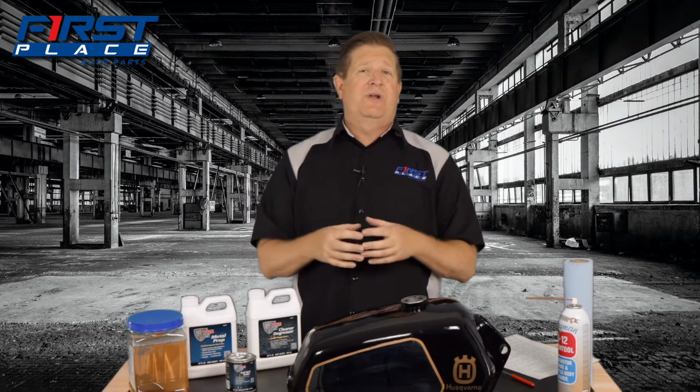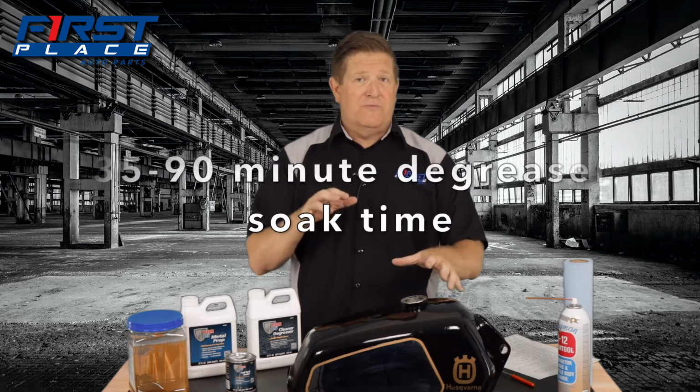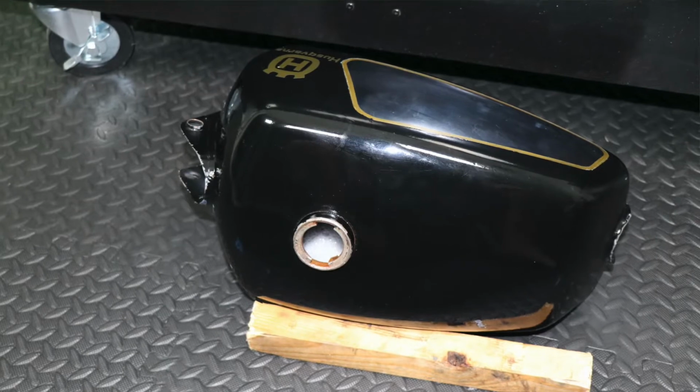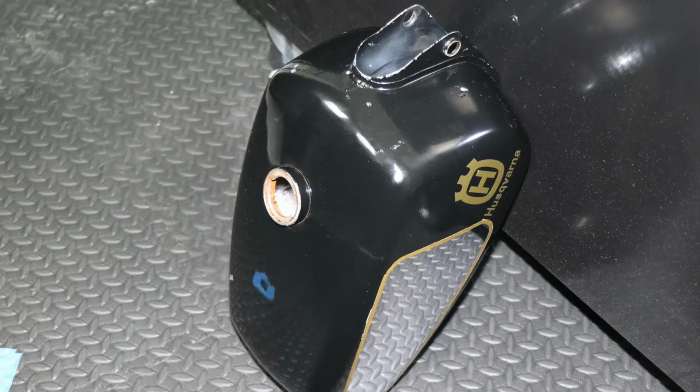Now, this process right here, what I would recommend, depending on what kind of fuel your vehicle had in it, I would roughly estimate about an hour to hour and a half of soaking to degrease the inside of your tank. And what I did when I did my tank is I would actually lay it on its side for 15 to 20 minutes, come back, lay it on its other side, tip it up on its end, tip it on the other end, and then ultimately I flipped it upside down